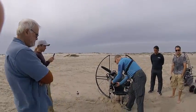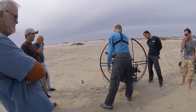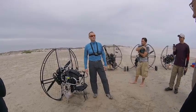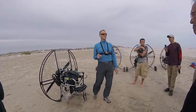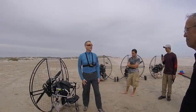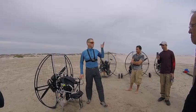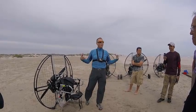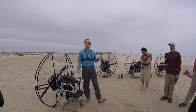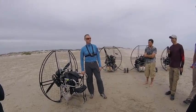For your first flight make sure the harness is adjusted properly with no pain. Also check your engine — warm it up for about 20 seconds and make sure it's running nice and clean and smooth all the way through the rev band to full throttle right before you launch. Don't launch in a manner where if your motor died you'd be in real trouble. You want to launch where if there was a problem you've got a safe place to glide and land at every second of every flight.